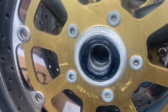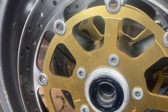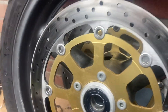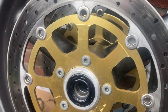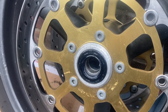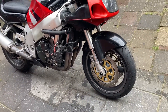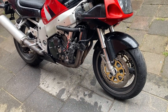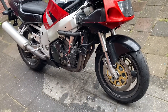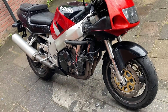Finally the wheel is complete — both new bearings are in along with the dust seals. I'm going to put it back on the bike, but I won't torque it down yet because I'm going to wash the bike first, since grease could fly around and get on the discs. After washing I'll torque it down. She's back on her feet now, and she'll stay like this for a while until I get the new tensioner and a few gaskets to swap on the top as well. I'll place the order and hopefully it'll be quick. That's it for this episode — thanks for watching, see you in the next one, bye bye!